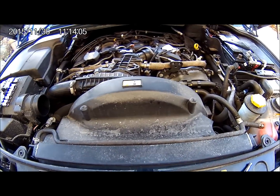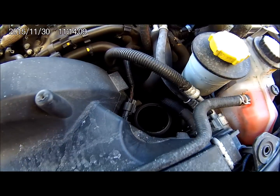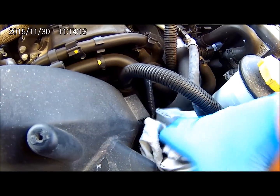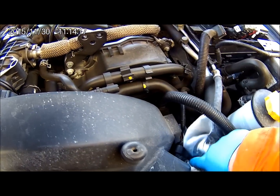That's just the air intake hose and the engine cover taken off. One little tip here — you've got that air intake there, and it's very advisable to stuff a rag in there while you're working, in case you're dropping anything down it.